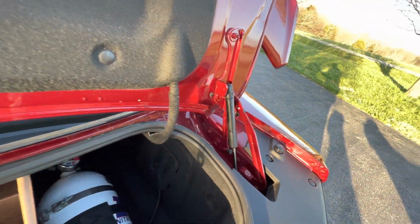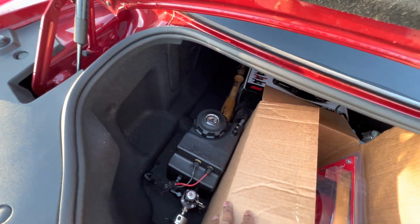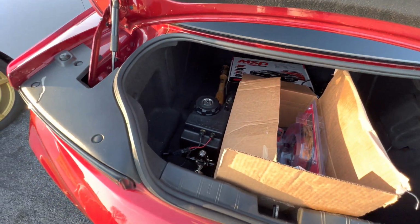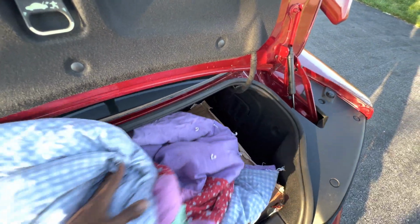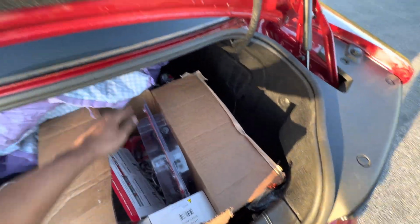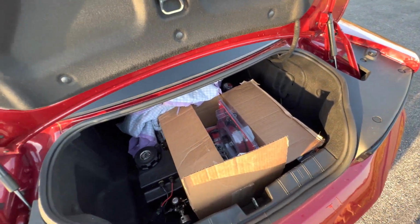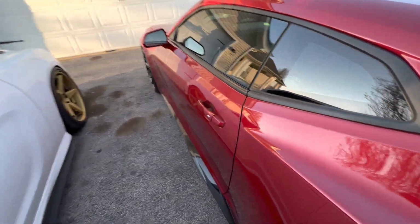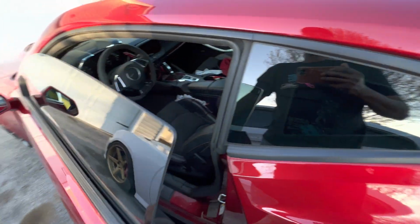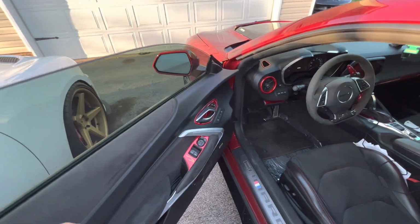What's this? It's my chain. Put that in here. And it is nitrous. It's a bottle, baby. So it's running on a 200 shot of nitrous and makes just over 850 at the wheels with the nitrous. And it's got a fuel system that I use, Nitrous Extreme by Renegade. Just because Renegade is around the corner from the track. So whenever I drive up to the track, I always go.